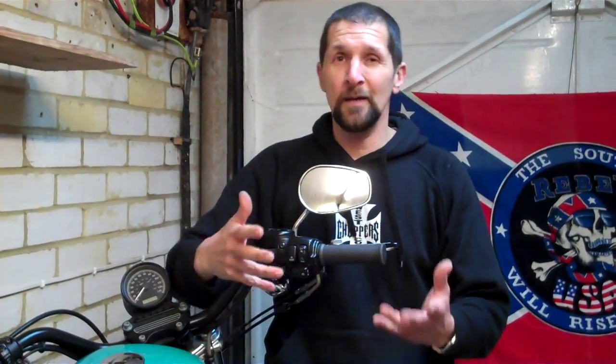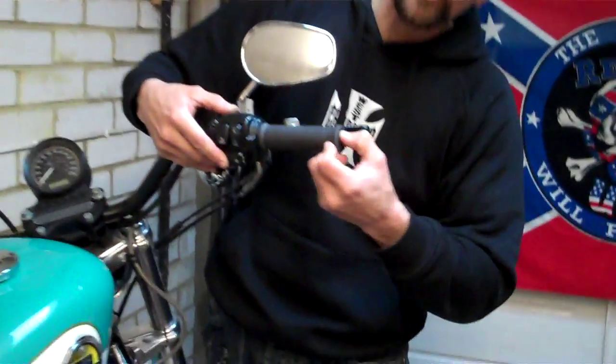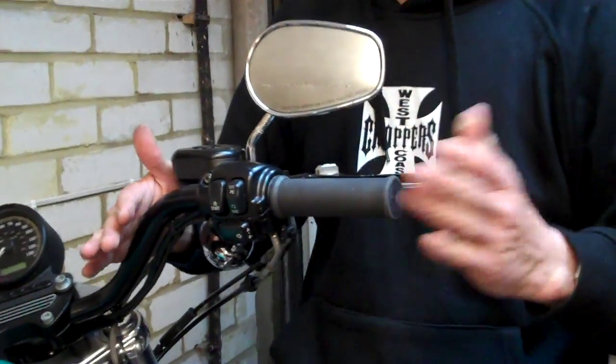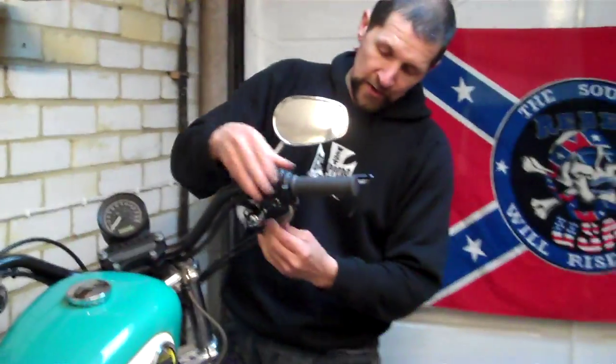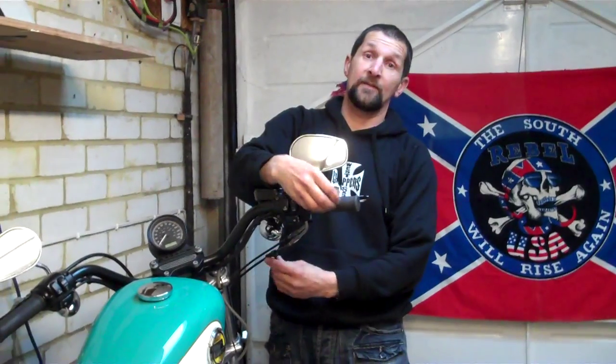That's all I can do — it's just a case of making sure it's all free. If it comes to it, you might have kinked the cable. Take the whole cable off and with the cable in your hand just run it in and out, make sure it's not sticking. It's just a case of eliminating every place. Very commonly, if you've pushed the grip on too far, even the rubber on the end can rub against the end of the steel bar and cause friction. Eliminate that it's not trapping there, then adjust it by simply expanding the adjuster — unscrewing it to make it tighter — until the cable goes too tight, then just back it off a bit to give it some slack.